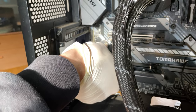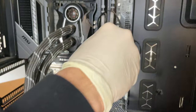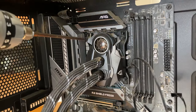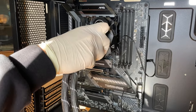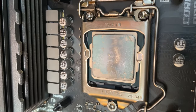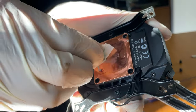We're also taking out the CMOS battery, which is an essential step before washing anything — it holds voltage, so skipping this would fry your hardware. Then we take out the RAM and the CPU cooler. The paste is some MX5 with a pretty bad application, but it did the job. Before washing, it's always better to remove the thermal paste because paste mixed with water spreads everywhere and is very difficult to clean up afterwards.